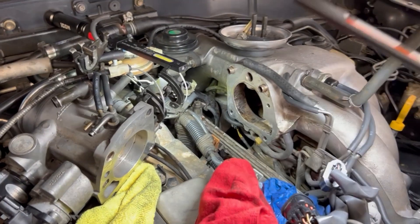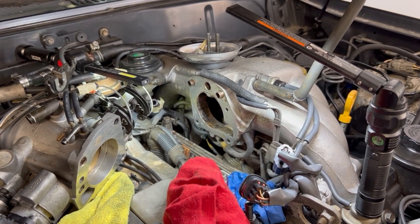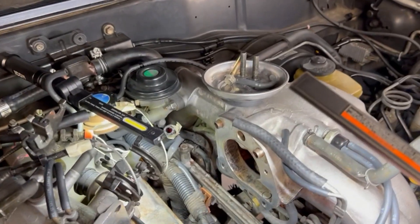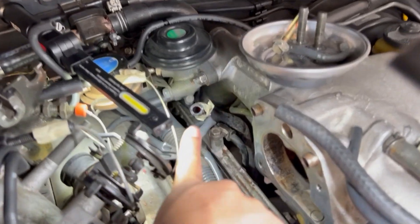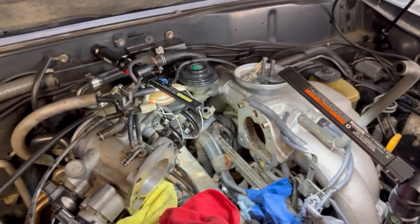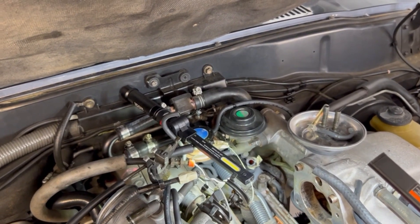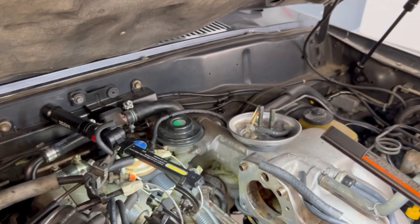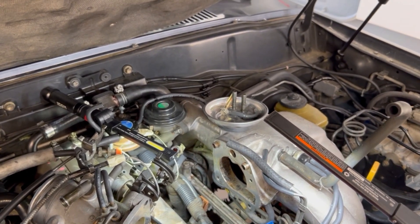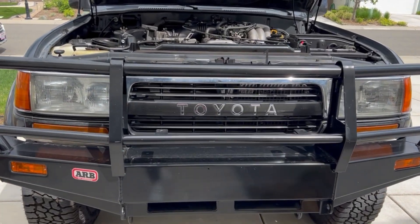So there you have it — that's another option to replace the VSV on the Toyota Land Cruiser without having to take out the intake manifold. It cost me like six or seven hundred dollars in parts alone. Just remember when you take it out there are fluids here, so get a bucket at the bottom so it doesn't leak. In hindsight I probably would have just cleaned out the EGR instead of buying a brand new one, same thing with the modulator. I think the culprit is this VSV valve that gets clogged — the O2 sensor was replaced brand new and didn't fix the problem, so this is the last thing I'm going to attempt.